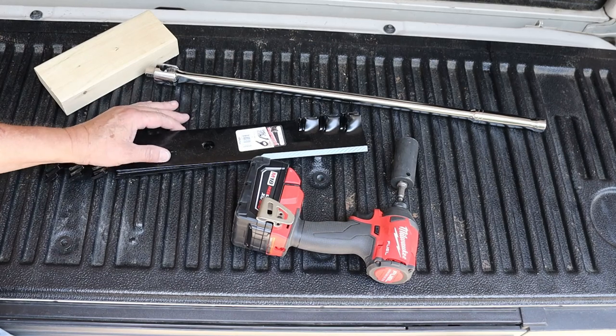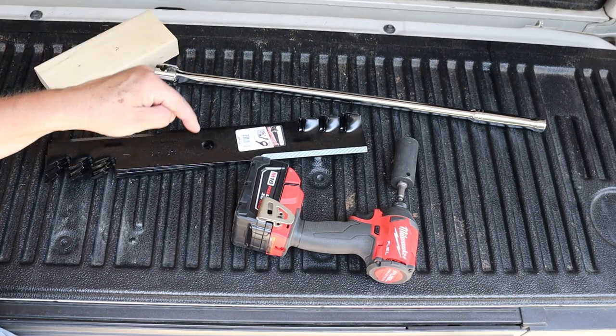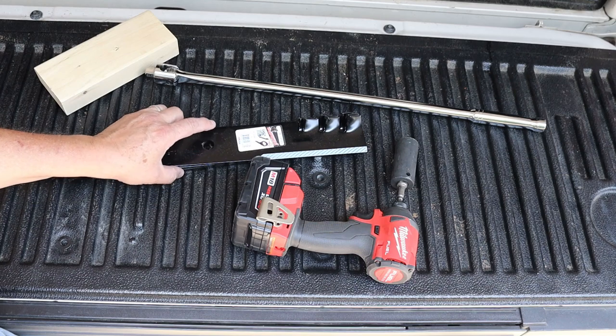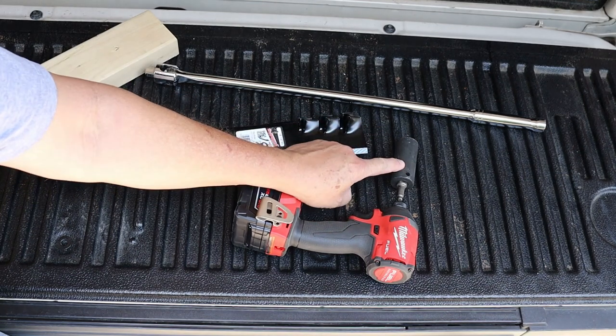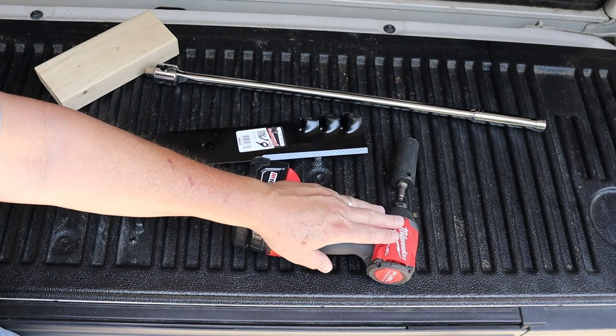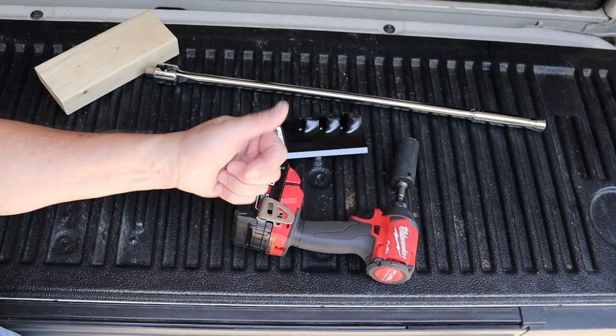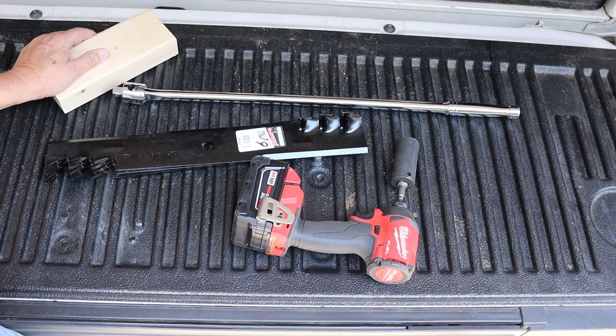In order to do this job, you're going to need your new mower blades. And I'll leave a link below on a source for your mower blades. You're going to need a 24 millimeter socket and either an impact driver, a pneumatic impact wrench, or a breaker bar and a block of wood.